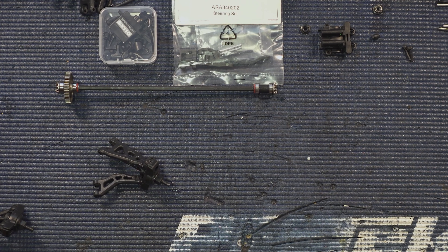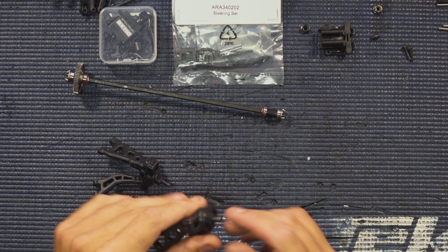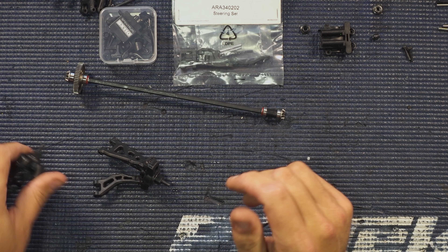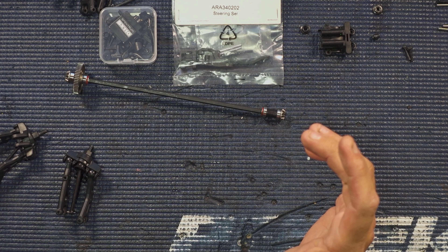What do I mean by the entire drive train? Obviously pulling off the front and back of the car, getting the drive shaft out, getting off all the knuckles and arms with our bearings, dog bones, and all that kind of stuff. We want to pull all of the shields off our bearings, which is a speed secret that oval racers and really any racers are doing constantly. These bearings aren't the best thing — the shields inside of them are cheap, they warp and cause binding issues.